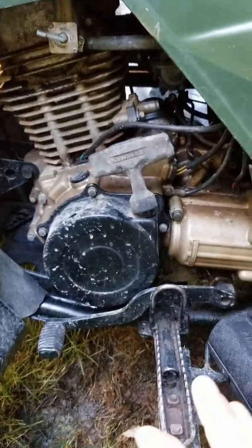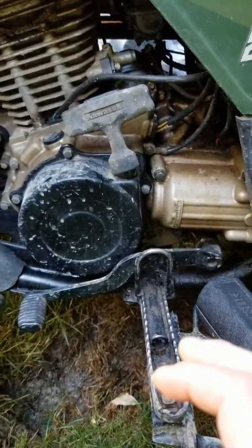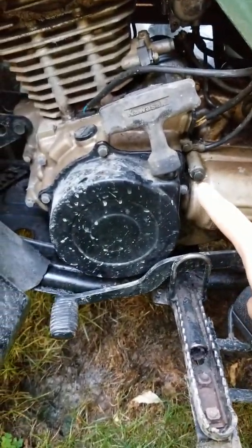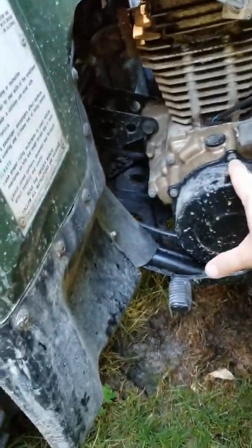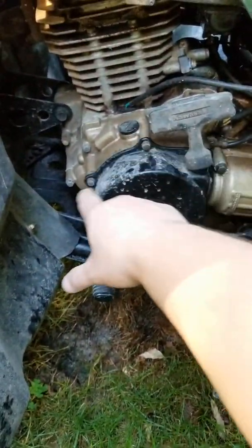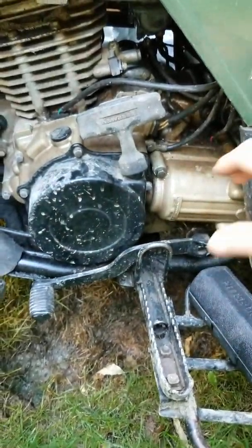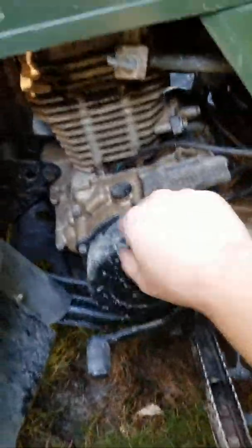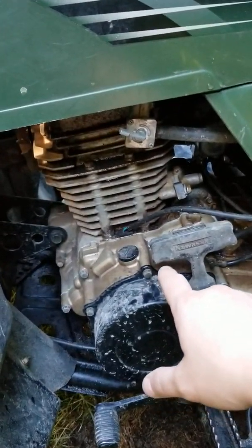In front of the big sprocket there's going to be where the woodruff key goes — the half-moon key. If you take the big sprocket off, on this side over here there's going to be a little small sprocket. And then this bolt right here is going to have to come off because you actually have to take this plate off. All of these little bolts in here — there's a big one on top and then the others are different sizes, so make sure you remember which one goes where.